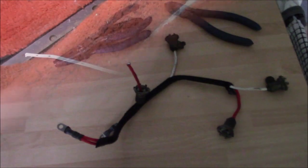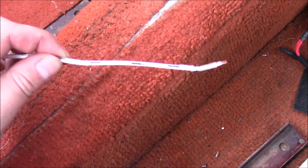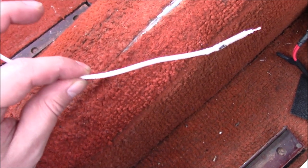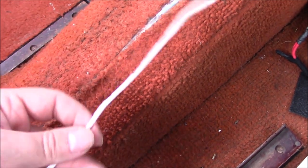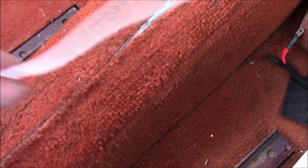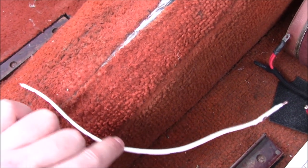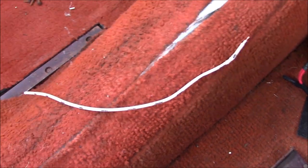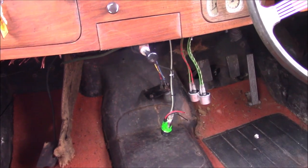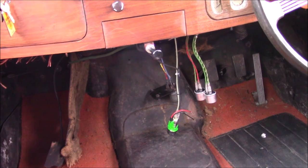The new wiring section here — I couldn't connect things up because the holders were incorrect. This should fix that. When I fitted those old sockets back, this wire was left over and isn't used, but it's the right length for doing the ignition-to-clock wire which isn't provided. So all I've done is used a marker pen to put some black dots on for identification. It seems silly to buy a whole metre of wire when I only need that much — this seems like a sensible solution. The wiring is basically done now.